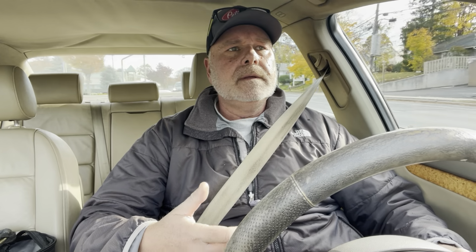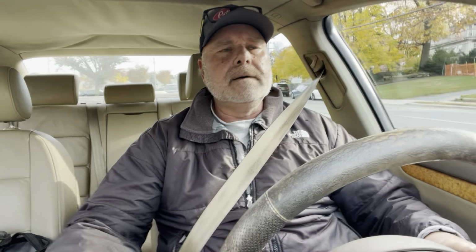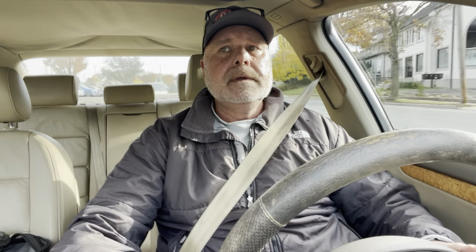Again, if you get a regen on a Peterbilt, find a safe spot as soon as possible. Once that signal goes off that you've got a high soot level, you must perform a regen. Now, typically a regen does happen while you're driving, to help keep that filter clean. It's all about airflow. So I couldn't perform the regen.